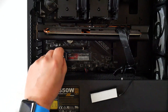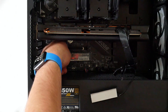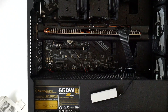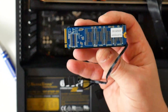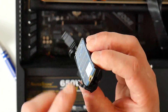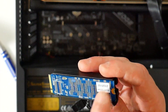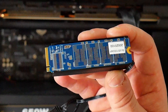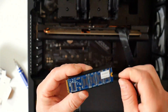Using a magnetic screwdriver, remove the screw from your M.2 drive and then remove the drive from the motherboard. Next, match up the indentation at the back of the drive with the section on the back of the unit. There is the drive actually in the unit — it's really difficult to do. I ended up putting the pad in first, then putting the drive in. You can see there are tiny little lugs in the corners. The lugs are actually really difficult to get in, so you do have to use quite a lot of pressure on the drive — I'm just hoping it still works.